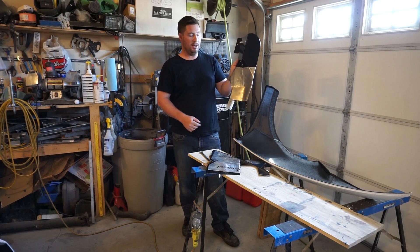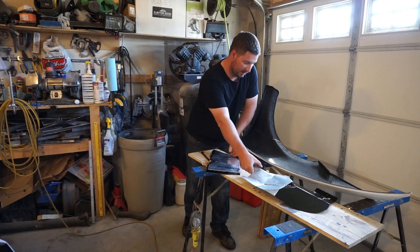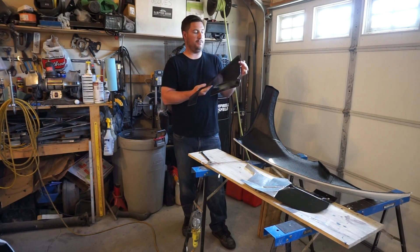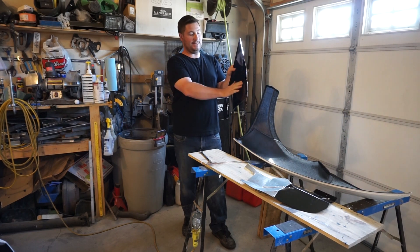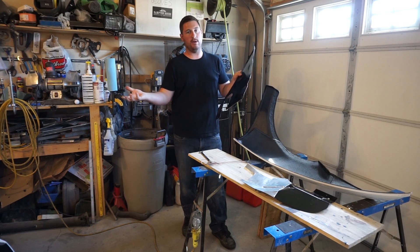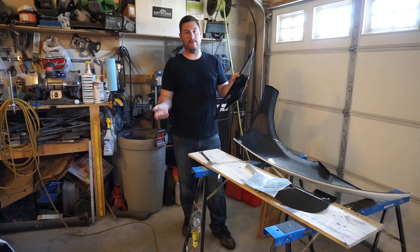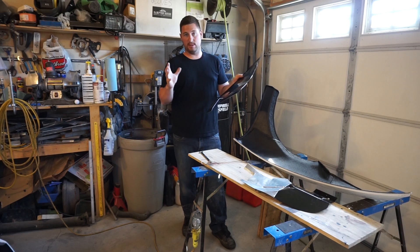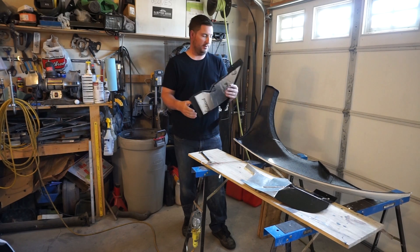This is the driver side; the passenger side is already done, I'll show you in a second. This is the supply panel — it just had to be modified and dented in a little bit because I'm running 1-inch larger diameter front tires. I'm at 25 inches total diameter versus the maximum 24 inches that Factory 5 recommends. To anyone else thinking about running bigger tires: don't. Just stick to 24 inches — the amount of work involved is not worth it.